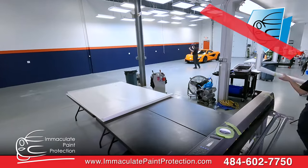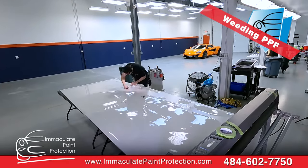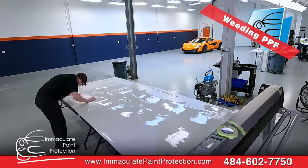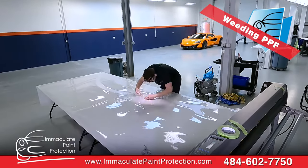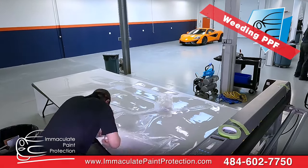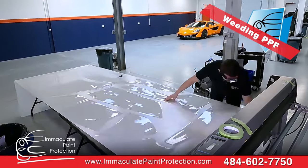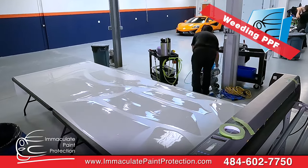At this point we've already cut all the PPF. We went through and cut everything — that takes some time, and it's an opportunity for error if the material gets misaligned to the machine. We've seen that happen before — it's not a fun day. Dan's over the table, he's clamped everything down, and he's going through the weeding process. He's looking over the cut file with his lamp on — picking pieces off. Some go in the trash, some stay on the table, and then we're gonna put it on the McLaren. We'll be doing PPF in probably the next 35–45 minutes.